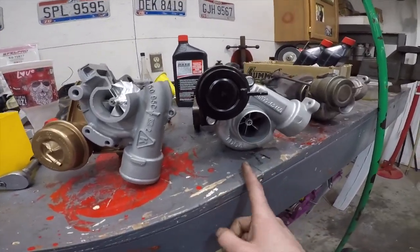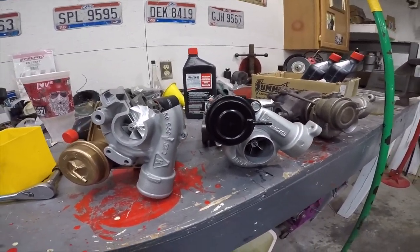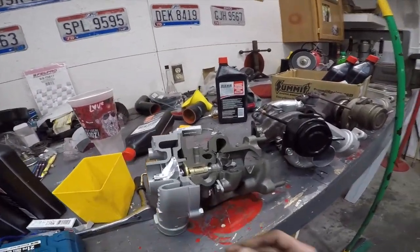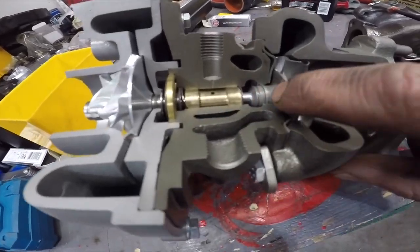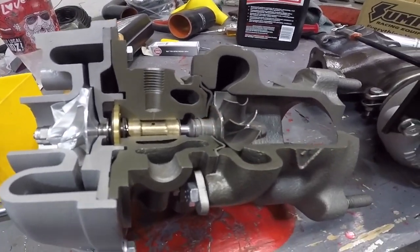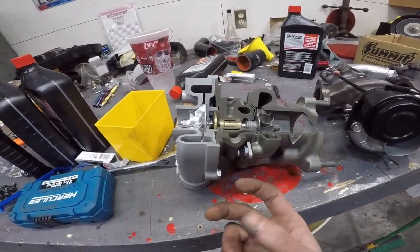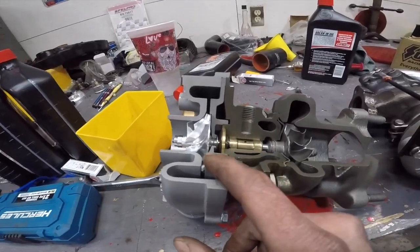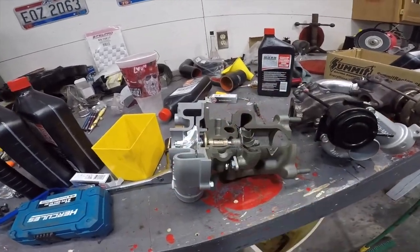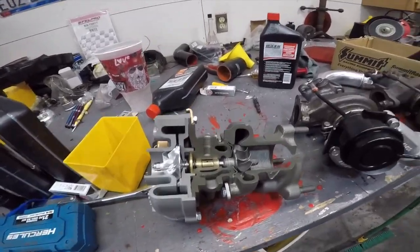XS Boost came over to look at my turbo. He says because I had too much oil in the engine, the oil return was probably getting clogged — I'm an idiot, I'll admit that. Look how cool this thing is though — turbos are simpler than I thought. The only way they can leak is if this ring right here goes bad; it's basically a piston ring. If the oil can't drain clearly — like if my return line was clogged because I had too much oil in the pan — it leaks through the ring gap. It's my fault.